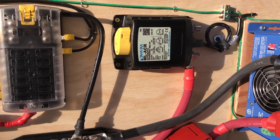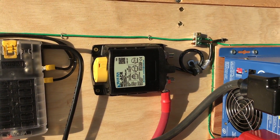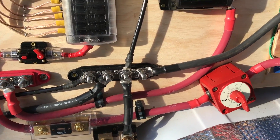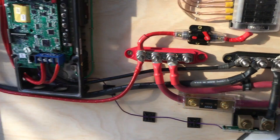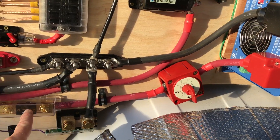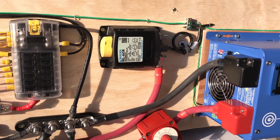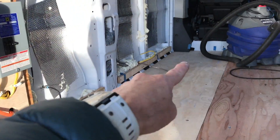Over here is basically a battery isolator. I'm going to run a long wire in from the Dodge battery that hooks here, and that will pass power to the bus bar, which then passes power to the battery. When the car is running and the alternator is running, it will pass the voltage here to charge the battery. So the batteries have multiple ways to charge: through the sun, through the alternator, and through shore power. This requires another 200 amp fuse hooked up to the battery, and I'll run it along the wall down through the floor all the way up to the battery.